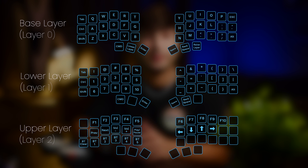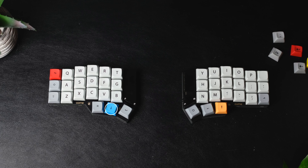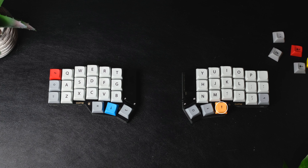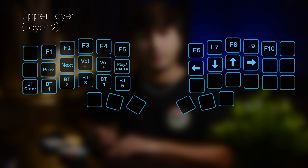So you might be wondering, if this keyboard is that small, how do you have access to all the different symbols and numbers that you would normally have on a traditional keyboard, especially when it comes to programming? Well, that's where keyboard layers come in. They're an essential part of using a keyboard like this. You can assign a specific key on your keyboard to activate a given layer where the keys have a different meaning from their default. For example, if I keep this blue key pressed on my keyboard, it changes to a different layer with only symbols and numbers, and if I keep this yellow key pressed, it changes to a different layer instead. I kind of like to think of this as a custom shift key. That's why this keyboard can stay so small, and it makes it so that nothing is ever too far away from your fingers sitting on the home row.